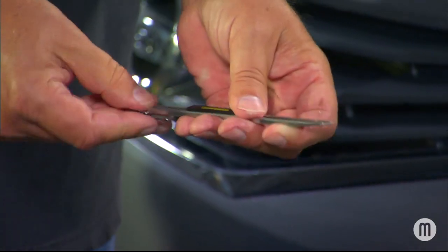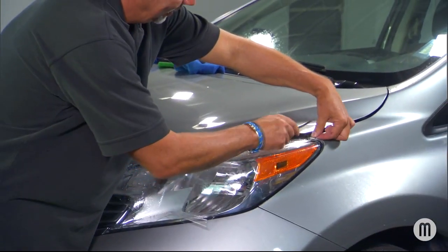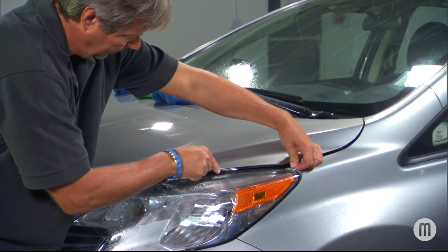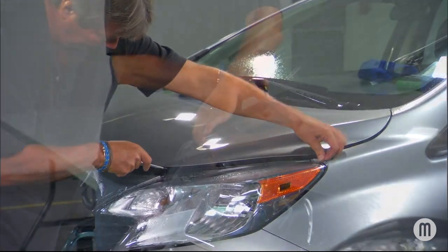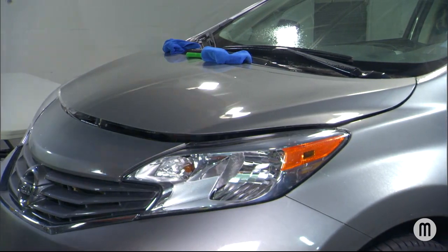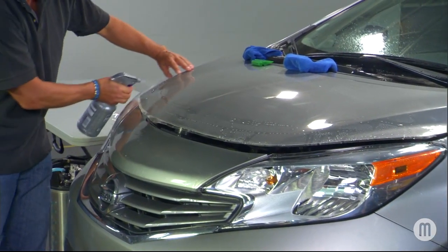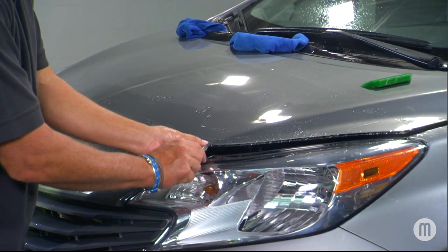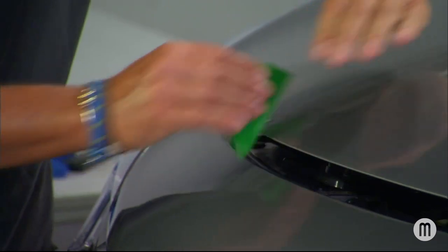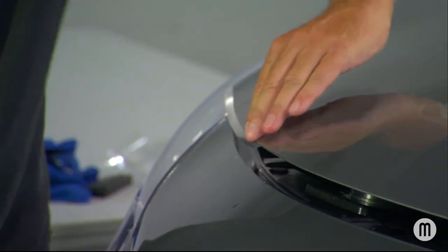Trim the overhanging edges, leaving about 1/4 of an inch overhang. Spray an alcohol solution on the overlapping edges and let drip dry for a few minutes. Score the film where appropriate to avoid buckling at critical points in the curvature of the surface area. Using your own hands in conjunction with the squeegee, roll the remaining film under the edge and squeegee down.